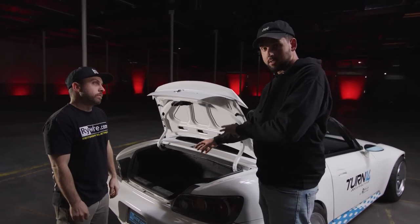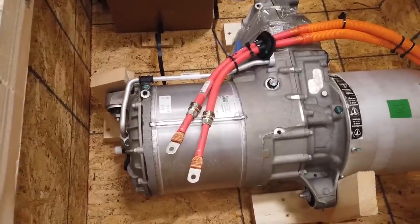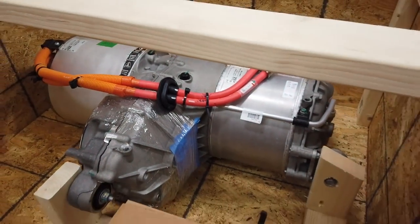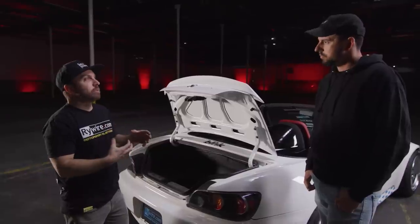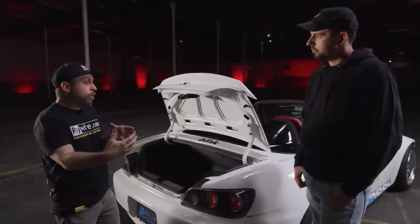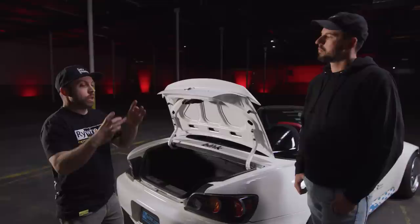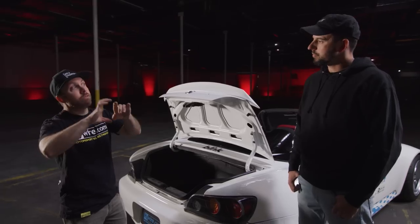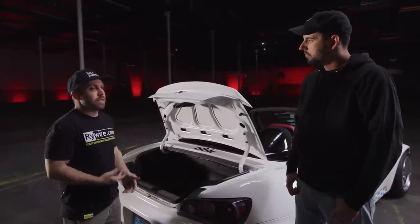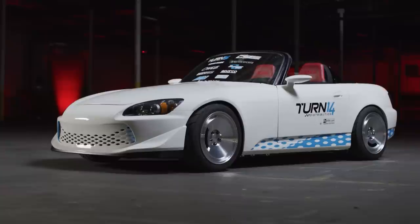So all of this craziness, it's got to power something. I have one single large Tesla drive unit. The cool thing about the Tesla drive unit is that it has a big motor, an inverter, and a one-speed transmission in the middle. So if you were to build all that system on your own, you're talking big bucks and a lot of design time. But Tesla already did that for you. The only real thing that's difficult is to hack into that CAN system to actually get that thing moving. AEM is able to do that with their control board — you take the factory Tesla control unit off of the inverter, snap in the AEM, connect it all up, and you basically have standalone control. You're off grid, not getting any Tesla updates. Elon ain't looking over your shoulder. It's just a motor with an inverter, with standalone third-party control that AEM has done.